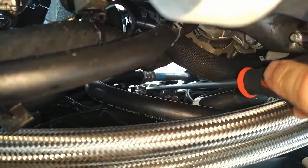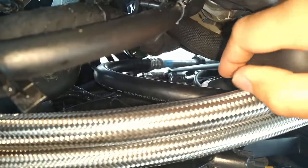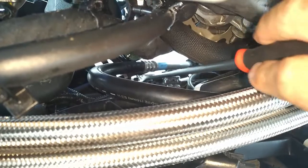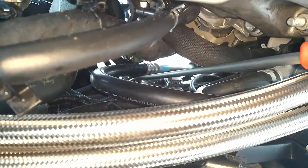and put it up in there. Got it around that spring. You need something that goes around the spring. Screwdriver will not work. You need something that can go around it. And just put it up there and slid it over. The one thing that you want to make sure is that you're to the left of the actual hood piece that comes in and locks.